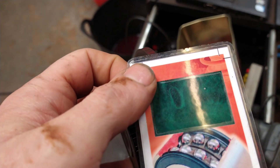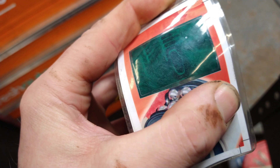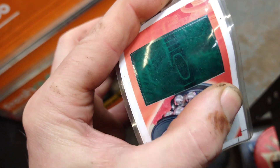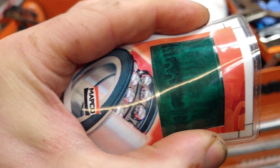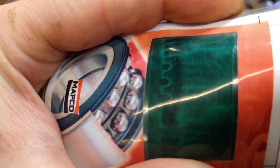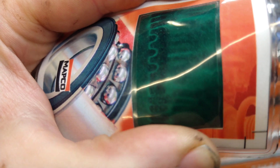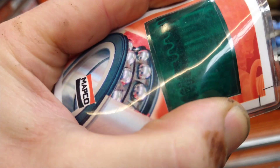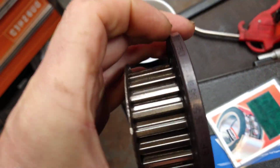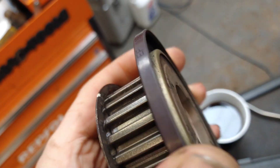It's definitely got a bit missing there. See that bit? That could be the bit that's supposed to be there. We'll keep looking for other bits of damage. I've got this bent around it to show it better — here's the damaged bit. It's not damage caused by anybody; it's just worn out. You can see the teeth are almost there, and that's the bit we were seeing on the scope — it was actually wider than the bit that should be there. That's what's causing it. It doesn't know where TDC is; it's getting a false signal from this bit. If I take that away, there's absolutely no damage you would have seen. It's just worn, causing the car not to start.